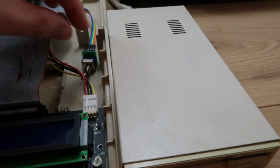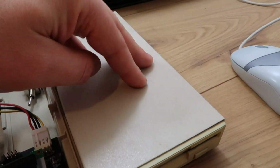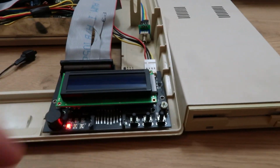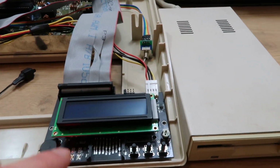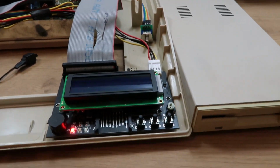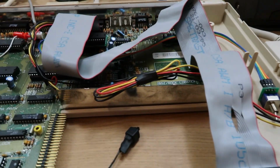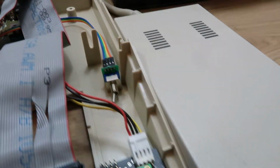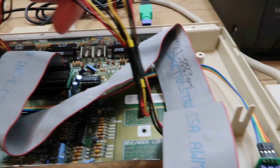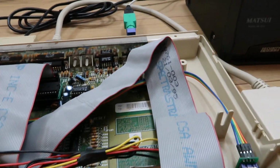So this then allows you to have this switch which you can toggle and set your external drive as DF0, and then you should be able to boot as normal, and then obviously that becomes DF1. This thing, I've been having problems updating the firmware and various issues, so it was set up but I never made use of it, unfortunately. Just a bit of a bodged power cable there to power that from the internal floppy drive. A bit more PC power supply recycling going on there.